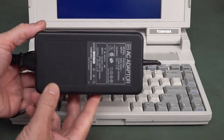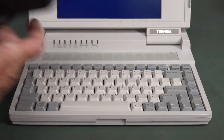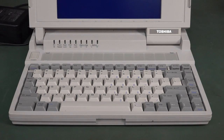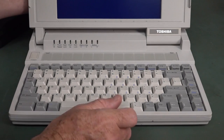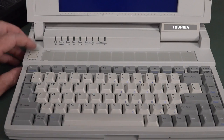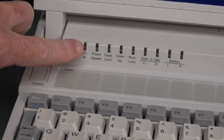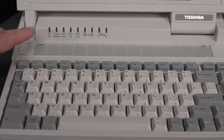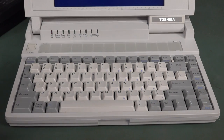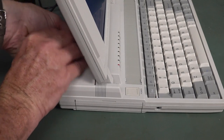This is supposed to be not working. Here's the power adapter - 12 volts, 1.7 amps. It is universal voltage so I can IEC straight in. We plug this in the back and confirm it doesn't power up. I am getting 12 volts out of that plug pack, but it's actually flashing the DC-in indicator. According to the service manual, that indicates low voltage. So possibly the plug pack is dropping under load, or maybe if I remove the battery that'll fix it.